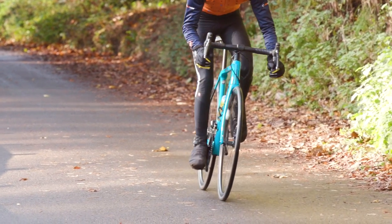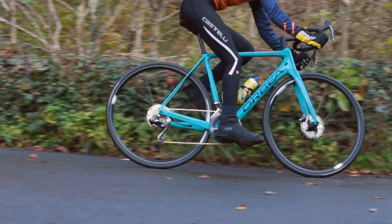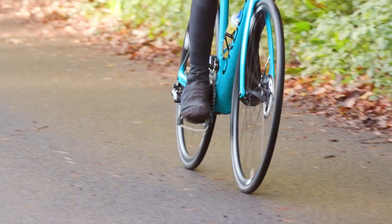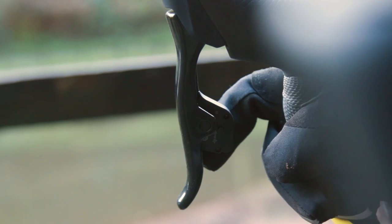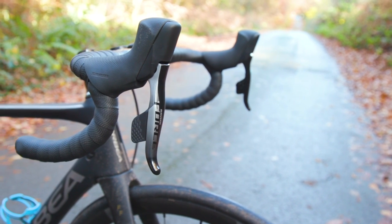Shimano's front shifting can feel a tiny bit quicker because, unlike SRAM, it doesn't have to decide if you meant to press buttons simultaneously. SRAM needs to make sure that you weren't just shifting one after the other. However, in practice, that's a tiny, tiny difference. I do think SRAM deserves a lot of kudos for taking a clean sheet approach when it originally came up with eTap. What they've come up with is, in my opinion, a much more elegant solution. Overall, in the real world, though, both group sets shift really, really well.